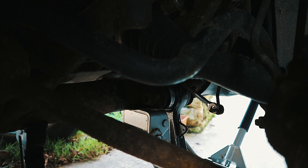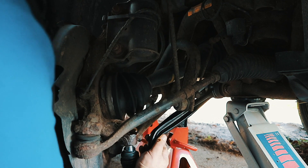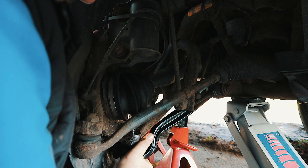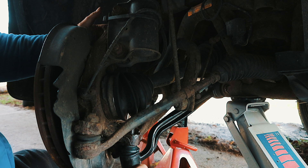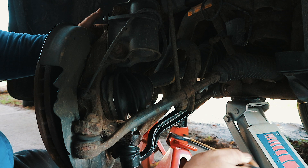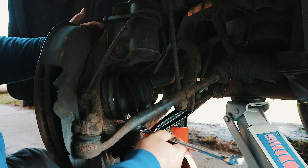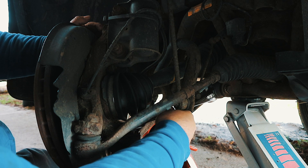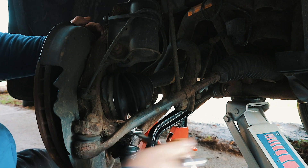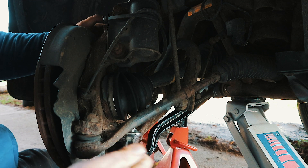All right, next job — get the ball joint in. I'm just going to bring the lower arm up to the ball joint where it goes in, just wiggle it about a little bit — and there we go. Get the new nut on there. What we're going to try and do is hopefully stop the thread turning inside the hub, otherwise we'll have to try a different method. As luck would have it, it's a different size nut — it was 21mm originally, this one's a 22mm — and we're hoping that it's going to tighten up nicely and the ball joint won't spin inside there. So far so good, fingers crossed.